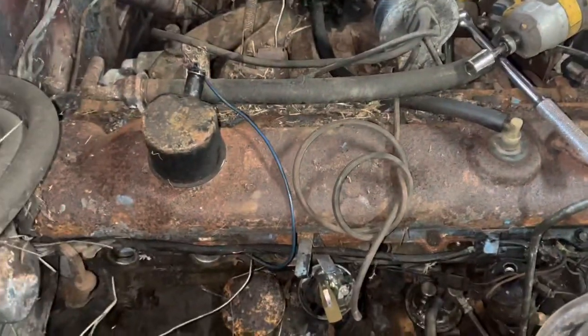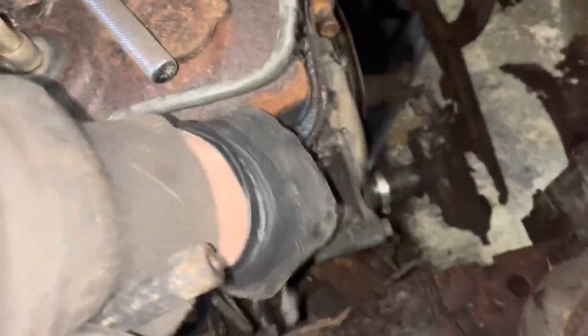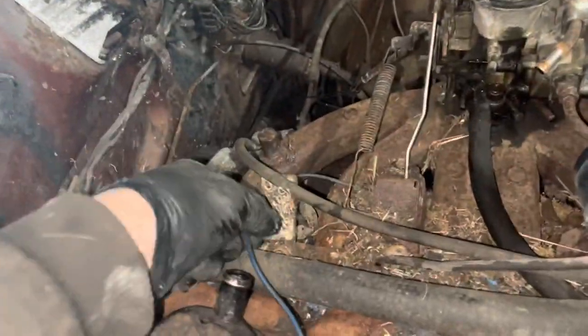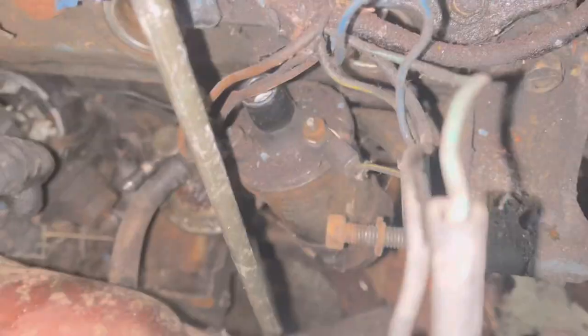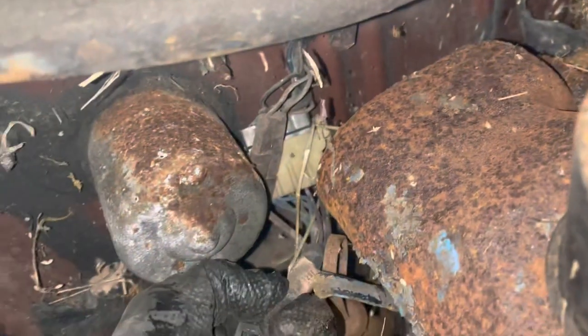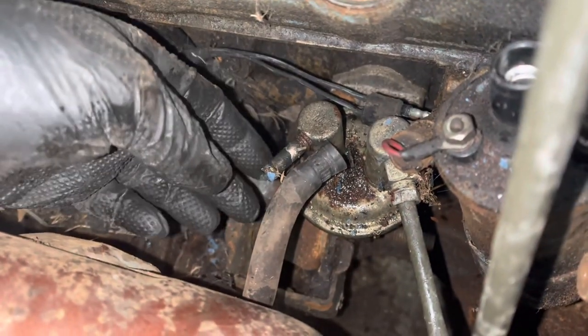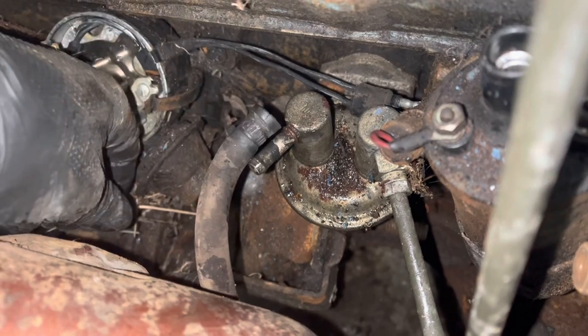When you're pulling the wiring harness on a slant, it's very simple — it all lives right here. You've got the two field wires that go to the alternator, the main charge wire, a water temperature sensor right there, a wire that goes up to the electric choke (which older models do not have), and a wire that goes down here to the oil pressure switch. Also the coil wires, which are really annoying to do. You can also just unplug it all from the car and leave it on the engine. Also, while you're down here, this is a good time to unplug the fuel supply line from the frame rail.